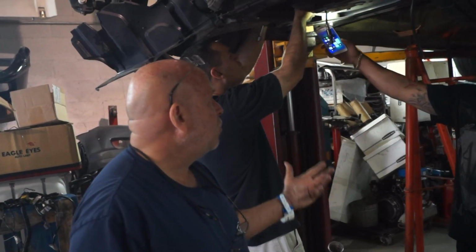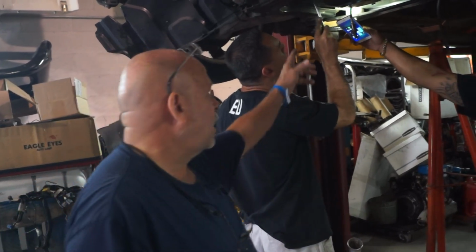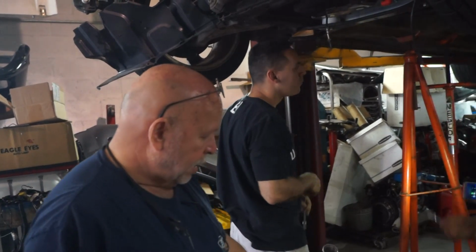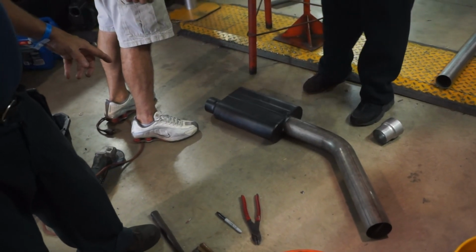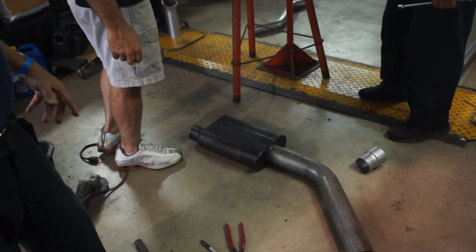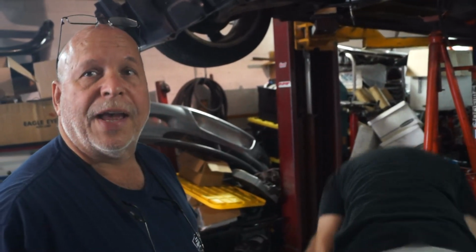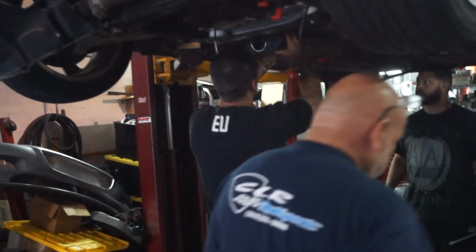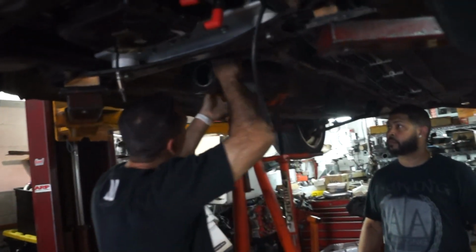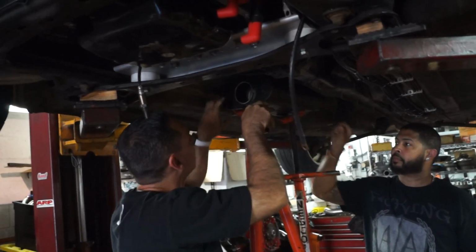Because of the temperature that rotary engines generate with the exhaust, even though the turbo will absorb 300 degrees, there's still a lot of heat in that downpipe. So using a medium-sized Flowmaster as a resonator on a rotary car is excellent. I've had excellent results doing that. Not only that, but at least to my taste, it adds a nice touch to the sound of the turbocharger. Deep, throaty, kind of rumbly. It fits beautifully in the space where the catalytic converter used to go, and handles the heat really well. This one doesn't have any glass packing in it, right?